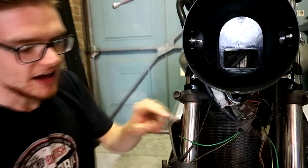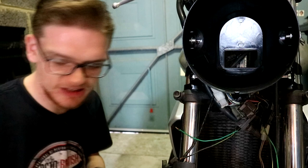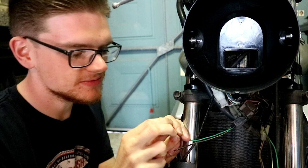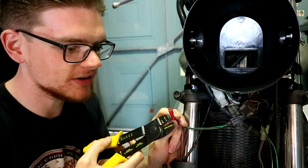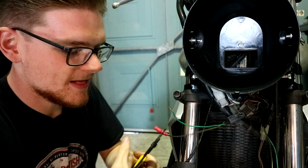Now we've identified that, we're going to be using bullet connectors, because on the new headlight it's already got male bullet connectors on it, so we're going to use female connectors to complete that connection. We've got our female bullet connector here and I'm just going to get the wiring inserted into it. Starting with the negative one — that's now inserted into a bullet connector, and I can just see the wiring poking through so I know it's in there. Then we need our crimpers — the 1mm one — grab hold of it like that and give it a good squeeze to mush it into place, and another crimp about halfway along.